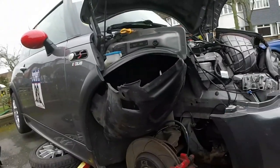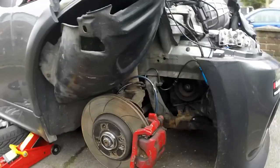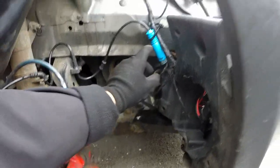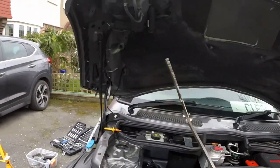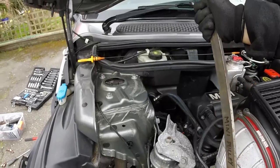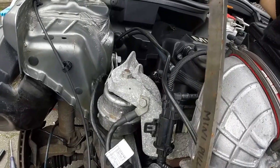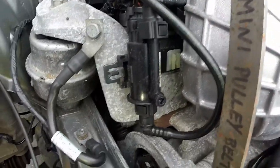So I've got my wheel arch liner off. All you have to do is literally just take the front half off and fold it back — you don't need to take the whole thing off. You've only got to get enough access to get to the idler pulley, which is in here. I believe it's a 13mm bolt. I've got my belt tensioner tool — it's handmade, I got it off a friend who went turbo with his mini. You just put it in — it rests on that bolt there — and that's going to tension all the way up. When you pull the belt pulley tool, this spring is going to collapse and you've got two holes. You put an allen key in the hole and that will release the tension on the belt.